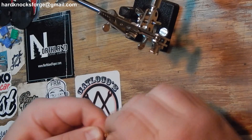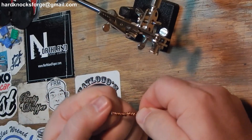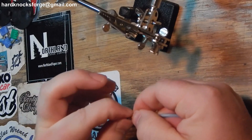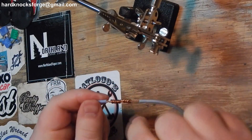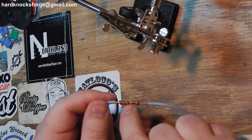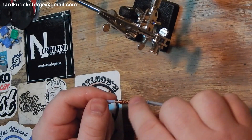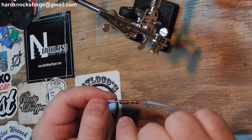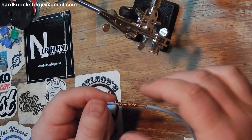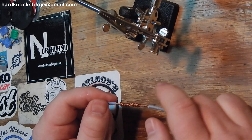This is what is commonly referred to as a linesman splice. And when you pull on it, it actually sinks in together and locks it in place. You're gonna tear these little strands of wire before you ever pull that apart. So a lot of times you can take this, instead of just butt connecting something, throw that splice in there, throw a piece of heat shrink over it with the goo in the middle, heat shrink that, and you'll be golden. That will last forever.